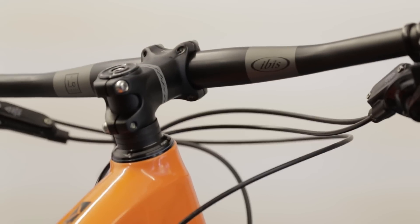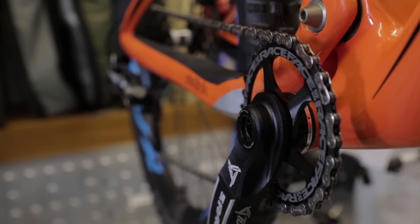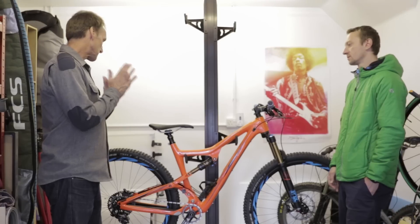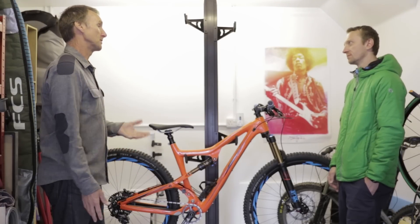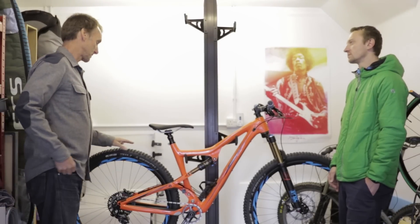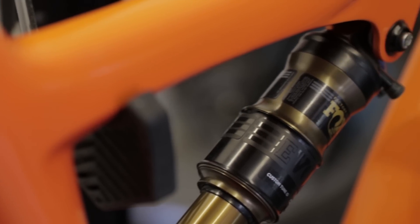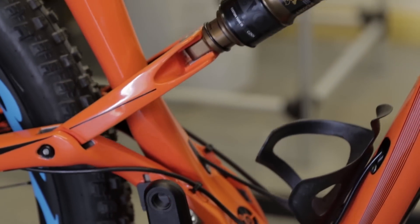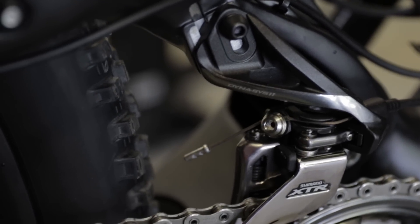So there's not clearance. Unfortunately it's really difficult to change the geometry down around the clevis, and that's the widest point — a 27.5 plus tire is right there where it would be the most difficult for us to change. So this bike unfortunately does not accommodate a B plus wheel. It's very tempting, and we've been riding the B plus wheels and we think there's a place for them. I don't think most people are going to want to ride them, but there's going to be a niche of people that want to go that way. In newer designs we'll be looking at accommodating that wheel size.